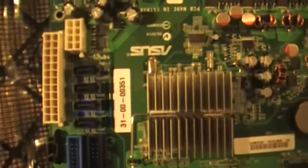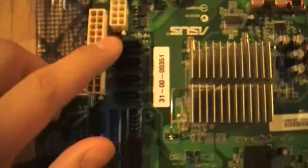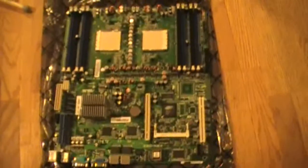There's also four free regular PCI slots. It requires a 24-pin power connector and an 8-pin connector. It has four SATA connectors, two hard drive connectors, and a floppy connector. Normally I'd say I have no clue why people still use floppy, but this is an older board, and it can be used to boot floppy-based things like BIOS updates.